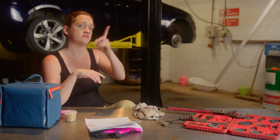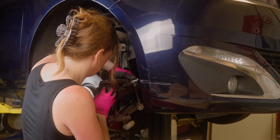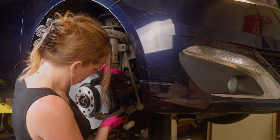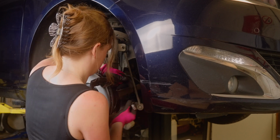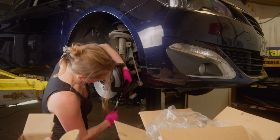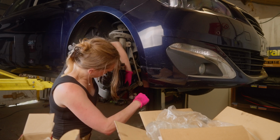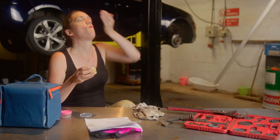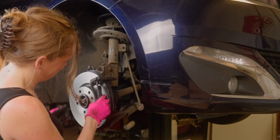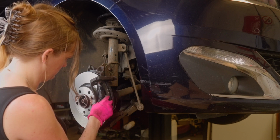The carriers. Just like our rear brakes, the fronts are a single piston design relying on a sliding carrier to allow the caliper to move in what is called a floating caliper design. With a little alignment, the bolts soon find their way home before being tightened to that setting. Pads again. In go our last pair of pads, complete with new guides and springs.